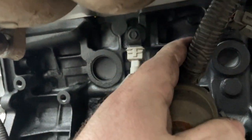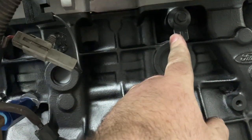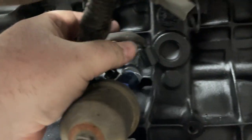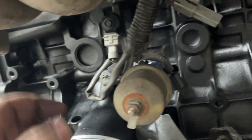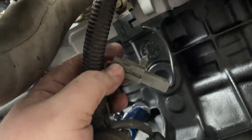it splits down. Coming down here, we've got a knock sensor. I'm using a BA ECU and a BA loom, so there is no rear knock sensor. Even though I physically have one, it's not plugged in; I'm just using the front one. Oil temperature sensor, I think that is. This plug here was the original BA oil pressure switch, but as I said, I'm using this other one to run my dash. That would have plugged into the BA sensor that goes there. I think this is some kind of noise suppressor or ground loop thing, I'm not sure.